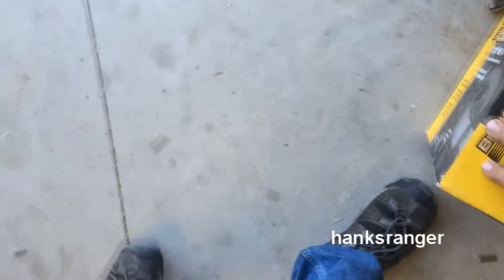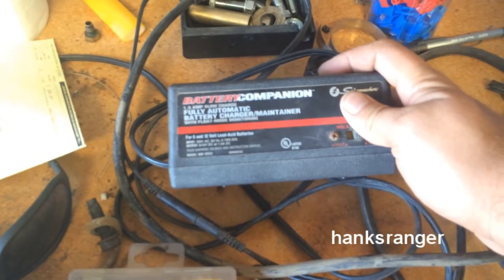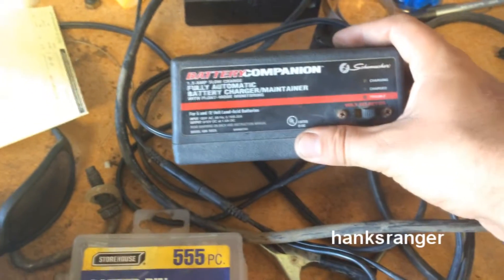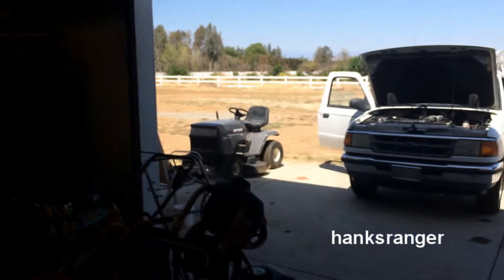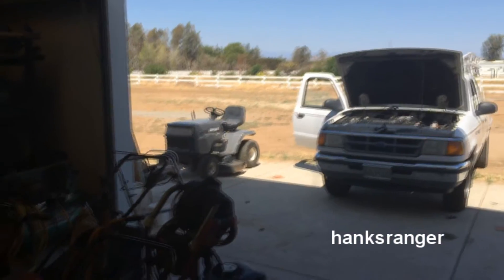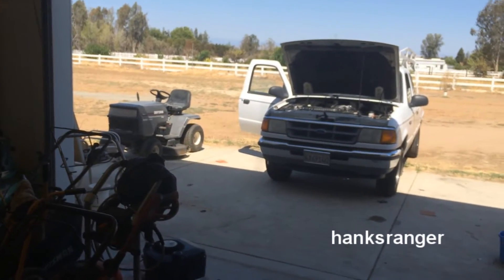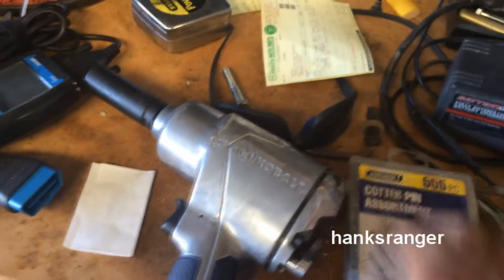I'll probably hit these next weekend. My dad also got a second battery tender from one of his ham radio deals — he got it in one of the loads he picked up. I was going to hook it up to that. The vehicle hasn't been started in about two weeks and I just started it today with no issue, other than it needing to build up vacuum for the gas from the tank to the carburetor. It took a little bit longer than normal to start because of that, but it wasn't because of the battery.